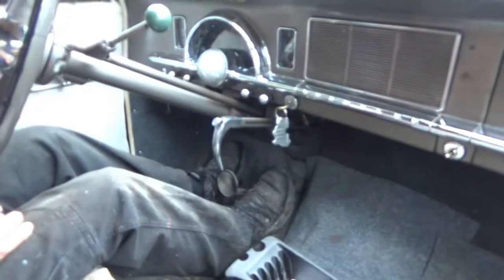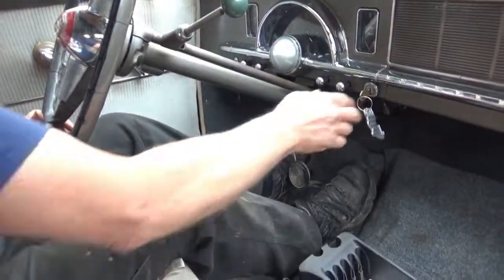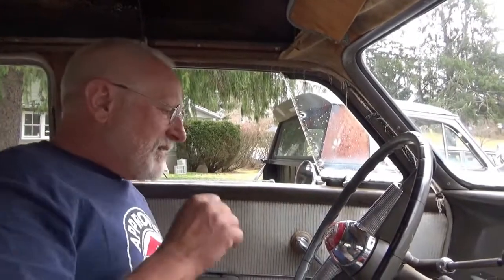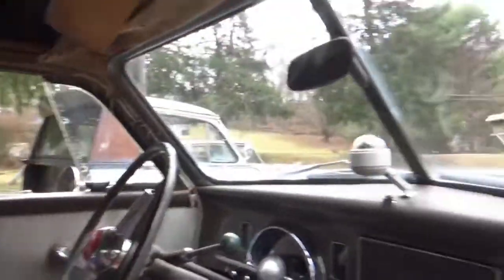Stupid six-volt cars are so hard to start. You turn the key first and press on the clutch — just press the clutch down. The nice thing is if you stall the car in traffic, you don't have to flail around looking for the key. Just press the clutch down hard and the car restarts, and no one will even notice that you made a mistake.